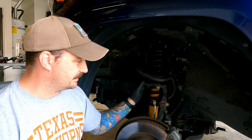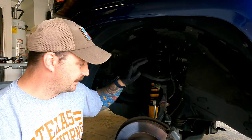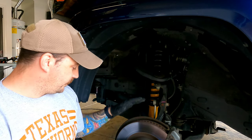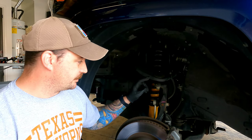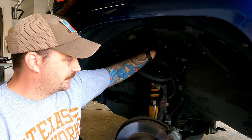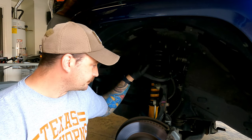You don't want to pull the castle nut all the way out before hitting the spindle, because there's a lot of built-up tension from your springs and struts, and the weight of it could make components fall and cause damage or injury. We have it supported with the jack and jack stand to make sure we're safe. We'll also remove the ABS line right here to move it out of the way so we can connect it to the new control arm when we reinstall.